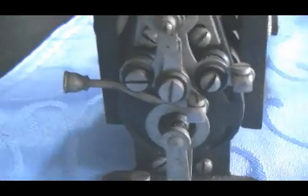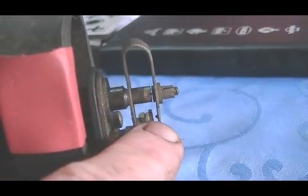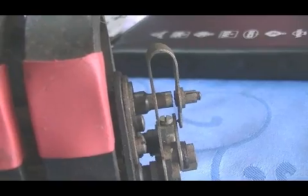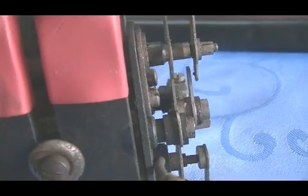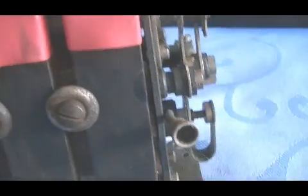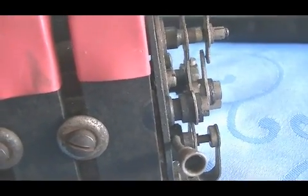I hope that's helped you out a little bit, Cultus. The lights aren't so good here, but to recap: this has a coil, a bottom set of points, and a top set of points. When you crank the handle one closes and one opens — then that one opens and the other closes — which delivers our coil spike on the open circuit. That's basically how it works.